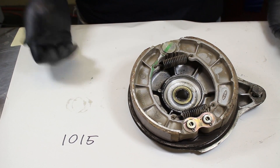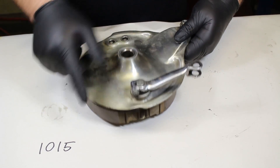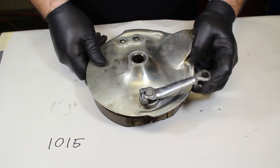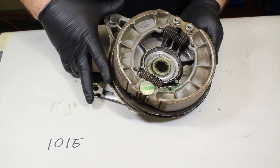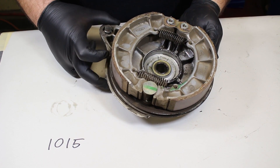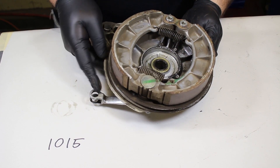This is off the wheel — we'll get back to the wheel in a minute. This is a single-pivot brake shoe setup. I've flipped this over — this is where the rod that goes to our brake pedal attaches. As we push the brake pedal, the rod moves. On the backside, here's the pivot, and as I move the rod the brakes expand outwards — that's where your braking action comes from, from this single pivot moving along, while up here they just hinge back and forth.